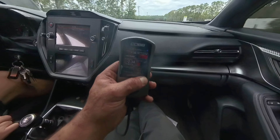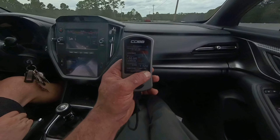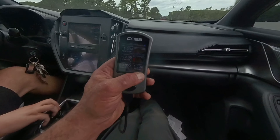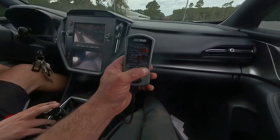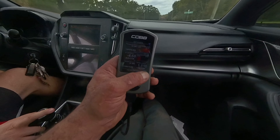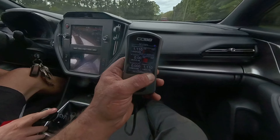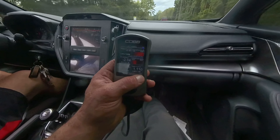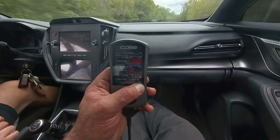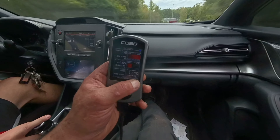On an electronic wastegate, this is how we can diagnose a lot of things — back pressure, possible boost leaks — based on wastegate position. A well-experienced tuner won't just guess 'that's the limit of the turbo.' A good tuner knows that if the wastegate should be open more at a given boost pressure, you either have a restriction, like a stock exhaust — which this car doesn't have — or you have a boost leak. Mass airflow frequency and catalytic converters will also change your wastegate position, even a large five-inch cat will back the car up.